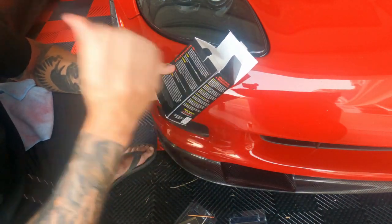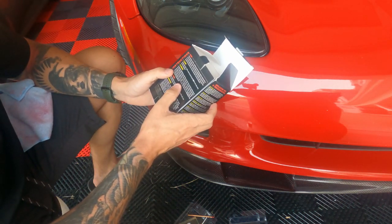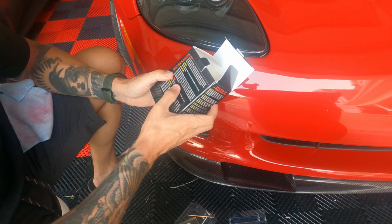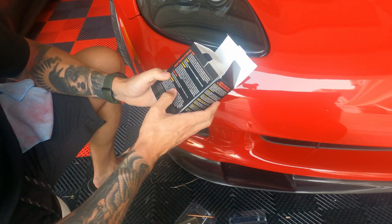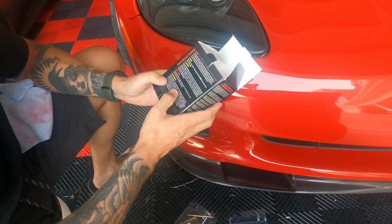Make sure paint is smeared flat. It should be dry to the touch within 2 minutes. A standing wet blob of paint allowed to sit in any panel may create haze in the clear coat. So smearing the paint flat is important. Dry time. The paint should be ready for step 3 after a few minutes, but may remain up to an hour.